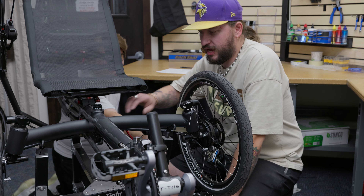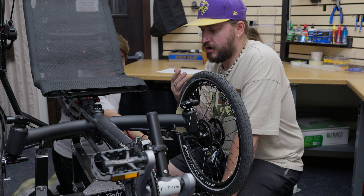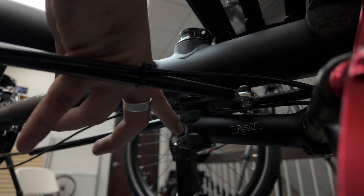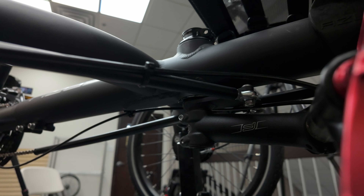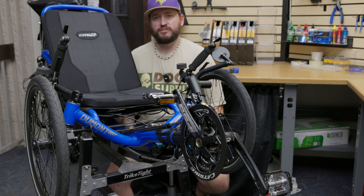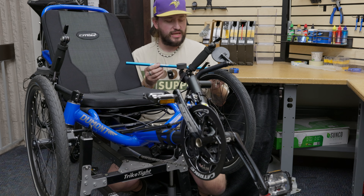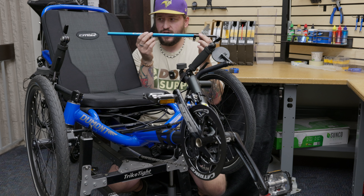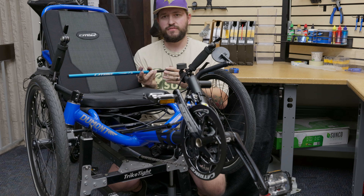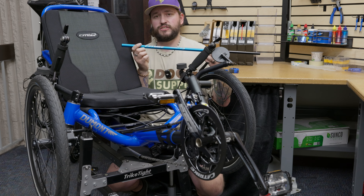With indirect steering you'll also have essentially a third spindle in the middle of the frame where the handlebar attaches. Once you get your toe alignment square, you want to make sure the handlebars are straight when the wheels are straight. If you need to adjust that, there's a head tube clamp down here — loosen it up and you can rotate it just like a handlebar on a Cat Trike. Cat Trike also has a pretty cool tool called the Calibro alignment tool — it works the same as a tape measure but is more of a visual gauge. You set it, line it up with the front, mark your distance, and compare front to back for a perfect alignment without having to remember a measurement. Link in the description.